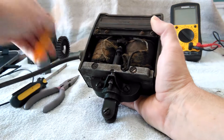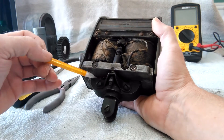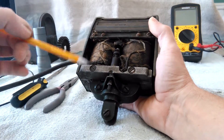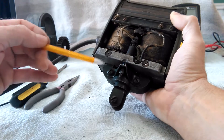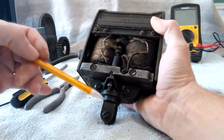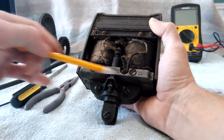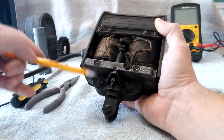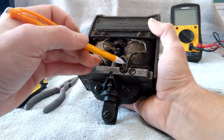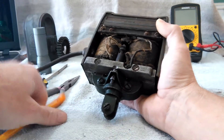Basically what happens: the armature here is closed, completing the magnetic field from the magnets. That comes down to your iron cores right in here, down to your armature, back up this iron core, back up to this coil, back to your magnet, back across, back down. With your magnetic field flowing and your armature closed inside your two coils, there's a primary set of coils and this magnetic field is charging that primary field.